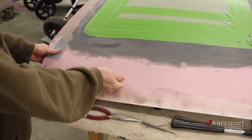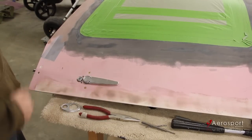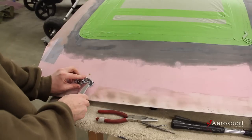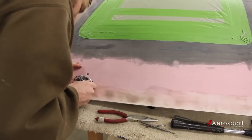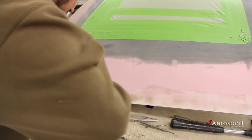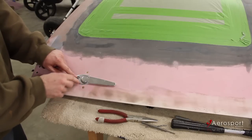The handle is installed and works great. Now it's just a matter of installing the beauty ring on top of the handle. To do that, we can just pull the handle out, bring it to about there, and slide the ring right over — it's a little bit of a tight fit, so you'll probably have to play with the angle. The outer ring is now installed. I can go from the inside and put those three countersunk screws in, and that will hold everything in place.